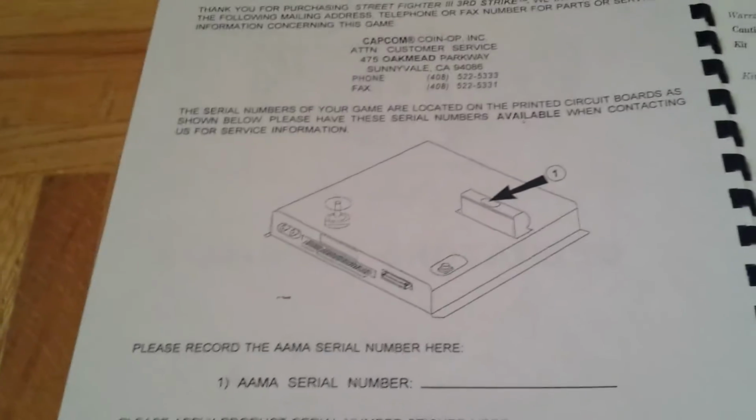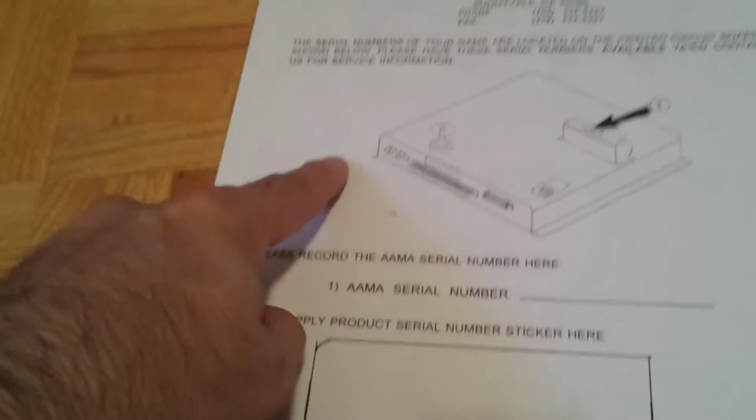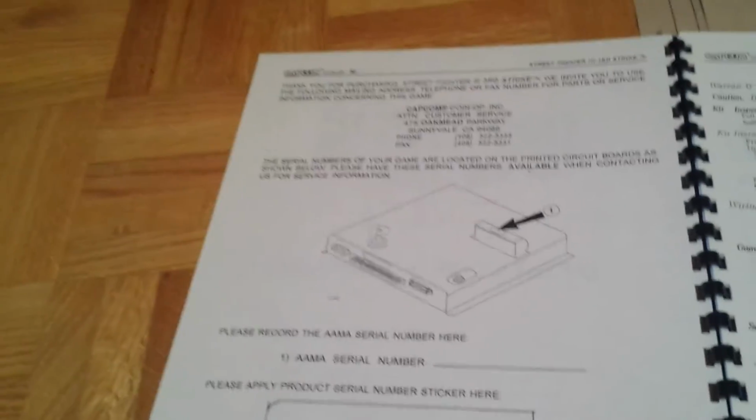This is the CPS3 system. That's where you would have the serial number, because it was very finicky. Let me undo the focus here. There we go. It's very finicky. That's the sound, and this has RCA jacks, so if you want stereo sound, you can do it. I do not have the part that is the Q sound, but maybe if that ever comes up, I'll do it. This is where you'd write in the serial number, because it was very distinct with the CPS3 system. They're very finicky. If you don't know, go to part 6 of my restore, where I burned the suicide battery. I'll do that momentarily when I show you inside.